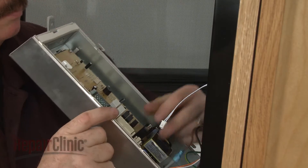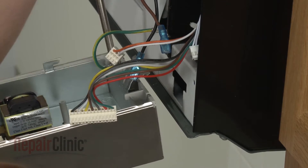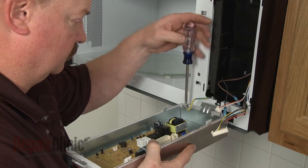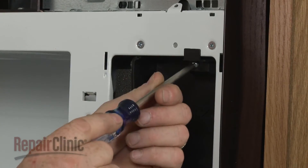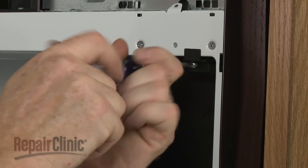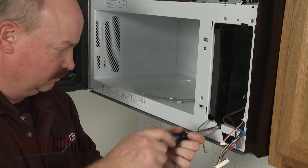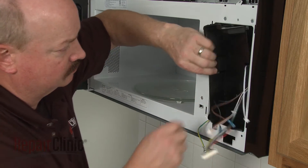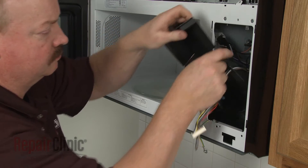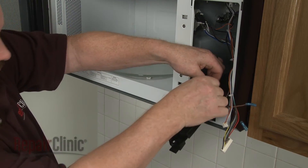Free the hinge tab from the front panel and remove the screw and washer securing the grounding wire. Next, remove the screws securing the plastic control panel backing. Detach the control board wires from the channel, release the sensor wire, and set the backing aside.